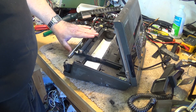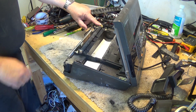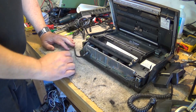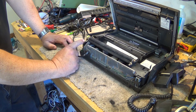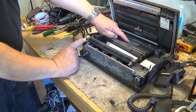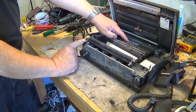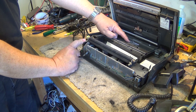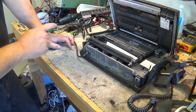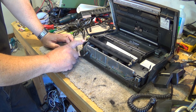This is the roller for the thermal printer with its one-way clutch and gears. These gears would quite often break on these things. It was quite unique how these operated: the motor went two directions. When the motor turned one direction, a one-way clutch would turn this roller, which would pull the paper through for scanning. Then the motor reversed — this one would freewheel and not move — and it would turn this roller to print. So one motor could operate both the scanner by turning one direction, or operate the printer by turning the other. Neat, huh?